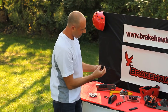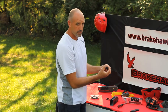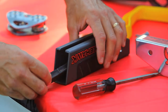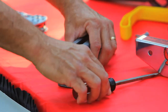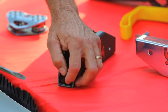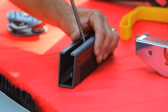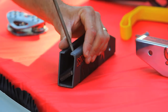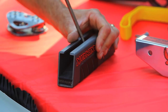Take your new brake pad — these are cut on a slight angle. You want the wider side of the brake pad to be facing up; it's kind of on a wedge shape. Slide it in here, just lay it in there at an angle. Make sure it's even in the back. Then just take the screwdriver through the cable channel and move back and forth, pressing on the high side. You'll feel it when it's seated in there.